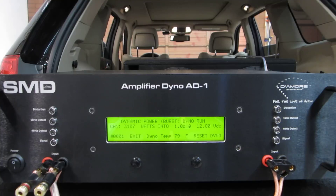Like your Camaro — you buy it, the sticker says 400 horsepower, but what does it put to the wheels? Same thing with the amp. The burst spec sheet says 3,300 or 3,400, but that's on a test bench at 100 Hz and 14.4 volts — things that aren't realistic in the car. In the car we're doing 40 Hz, hooked up to the car's electrical system. The continuous tests — certified or uncertified — are both accurate real-world numbers. We saw our electrical system isn't quite up to the task but still did almost 2,000 watts. So this is a good opportunity for a dealer to say there's power you're not getting out of your system. That covers dynamic power, continuous power, certified, and uncertified.